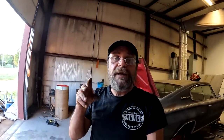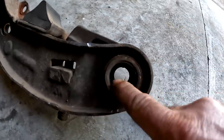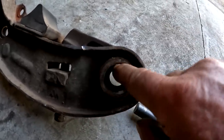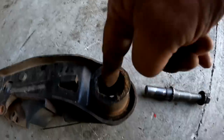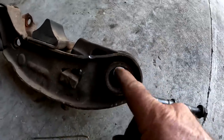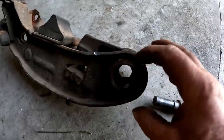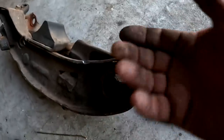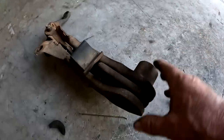That's not the way to do it — that's just what Chrysler says. The easiest, most expedient way I've always done it is: take a nice thick washer, lay it in there, weld it around the shell, then get in from the other side with a drift and knock the shell out. The heat from the welding and then cooling breaks the grip, and it'll tap out pretty easily. That's the easiest way I've found.